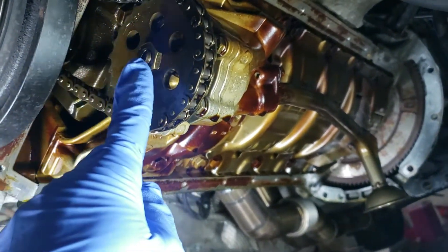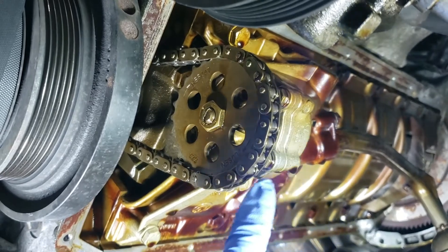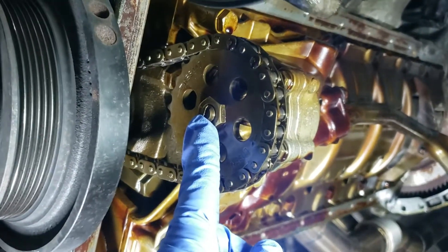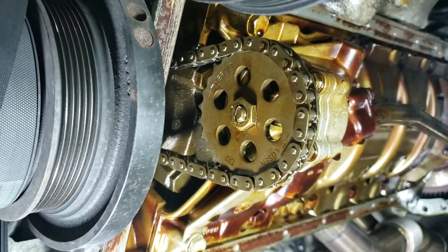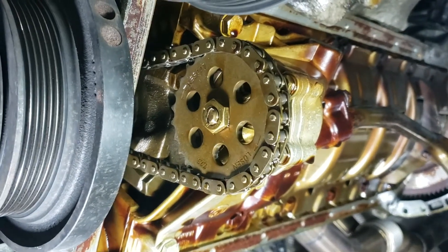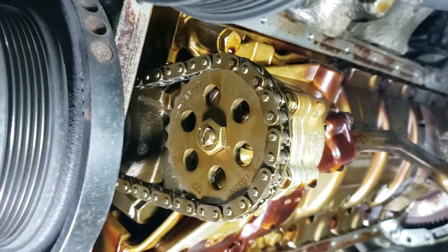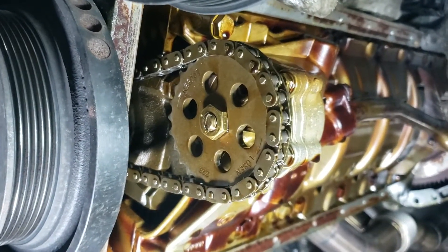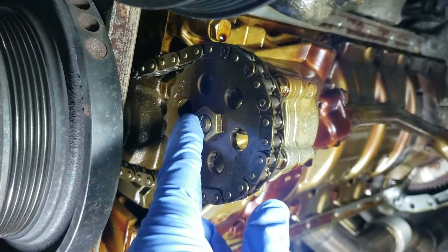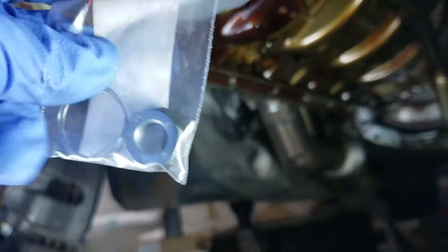Here we are at the front of the engine, and this is a major reason why I went through all this trouble to remove the oil pan. This is the oil pump — you can see the chain that drives it and also the oil pump nut. The forum lore is that this oil pump nut can come loose and cause a whole bunch of problems: loss of oil pressure, metal clinging around in your oil pan, etc. But some of this forum lore also suggests that this really doesn't happen on the 2.5 liter or even 2.8 liter M52 engines — normally when you find loose nuts here, it's usually on the 3 liter and up.